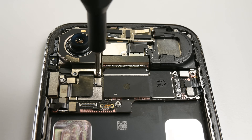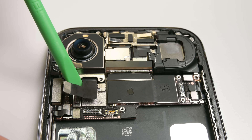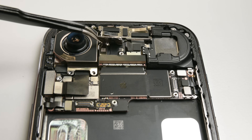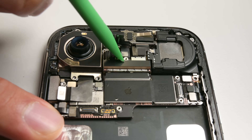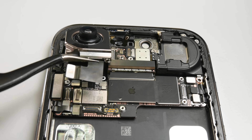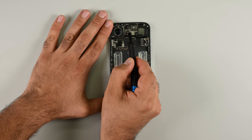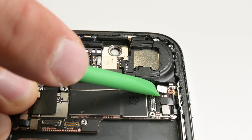Back to the teardown — the upper assembly is where most of the remaining components live. The main camera seems ready to come away with two screws and a press connector, but a small flex cable running across holds it back. Removing a bracket releases what looks like the front camera's flex cable — but it still won't budge. I decide to remove the front camera assembly instead, revealing yet another flex cable split in two leading to a microphone glued to the frame. A Phillips screw in an awkward position makes it impossible to reach without risking the logic board, so I move on to the sole speaker, held by just three screws and a press connector — mercifully simple.